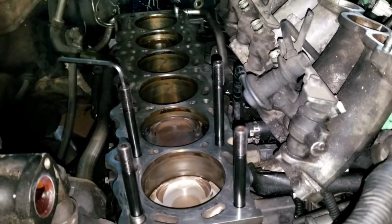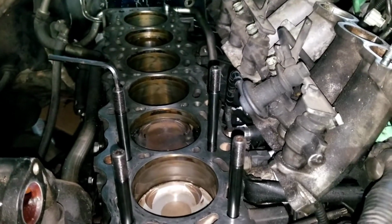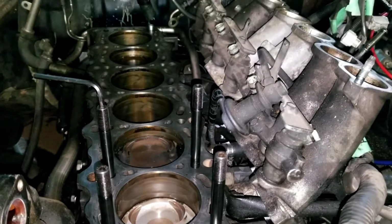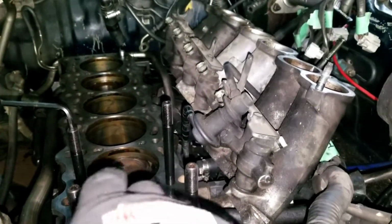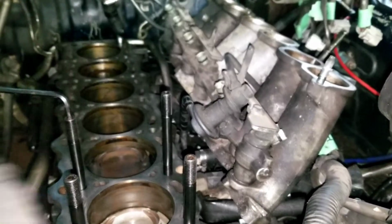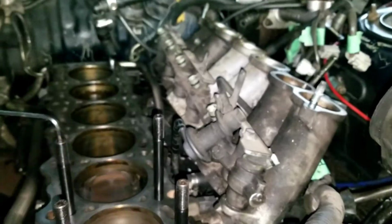Right, onto the reassembly process here. So I've got my clutch all installed and everything, and now I am doing the cylinder head. I've cleaned the surface using a Roloc disc, which is a little gritty finger disc that takes away the extra rubber. It is smooth. Anything that you see on there is actually just staining. I didn't want to dig it all out and cause imperfections in the head. The head is straight, so is the deck, so is the cylinder head over there.